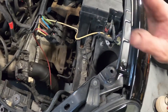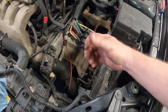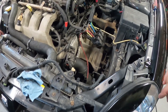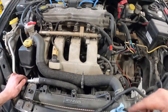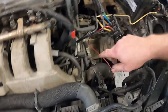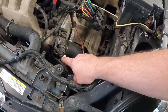Now we can see the transmission. We're going to undo this pipe. You can do this two ways - pull the throttle body and spacer off to get to the starter bolts, or pull the entire intake. I prefer to pull the entire intake. It still has the little dog bone bracket which will be fun to get. Pull these off and out of the way so we don't break them. Wrap a rag around here because fuel always comes out when you pull the line off. Undo the two bolts for this bracket, a couple 10mms across here, and we'll remove the entire intake.